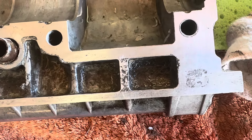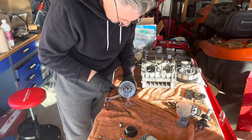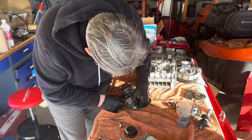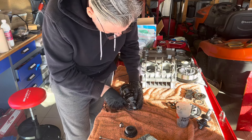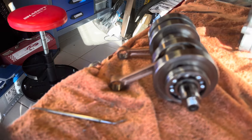I'm taking a look at the crankshaft now, specifically looking at that small inner seal that sits behind the transfer gear and the main engine oil seal. I'm taking all of that off to expose the inner oil seal. As I said earlier, I think that might be the original one and I'm not overly confident it's still secure. There behind the woodruff key — which I've already taken out — is that small oil seal. I'm convinced that's the original oil seal from 1977. Having brought a new one from Yambits while I was back in the UK, I just want to gently prise that old one out to see its condition, but I'll replace it anyway.